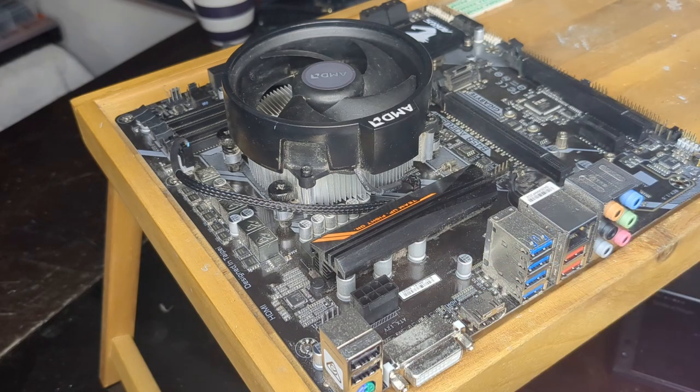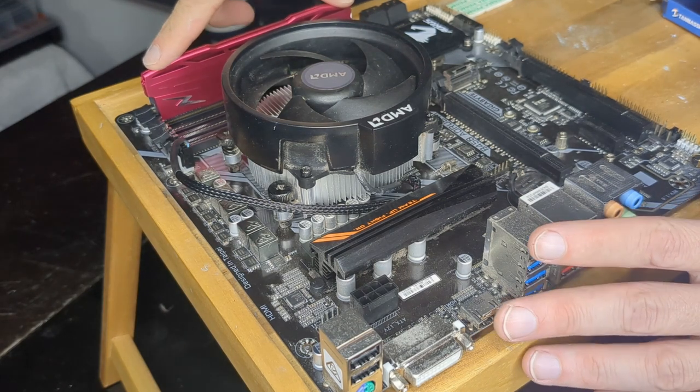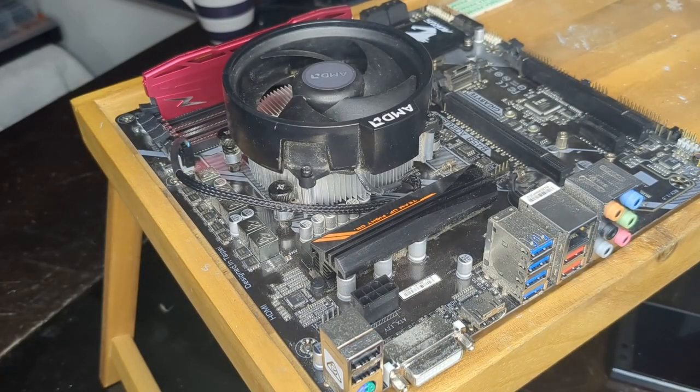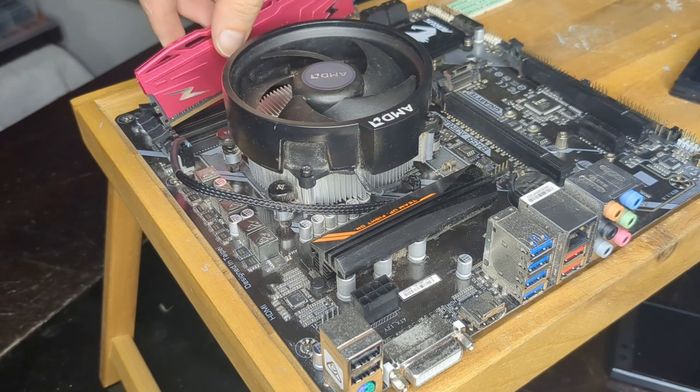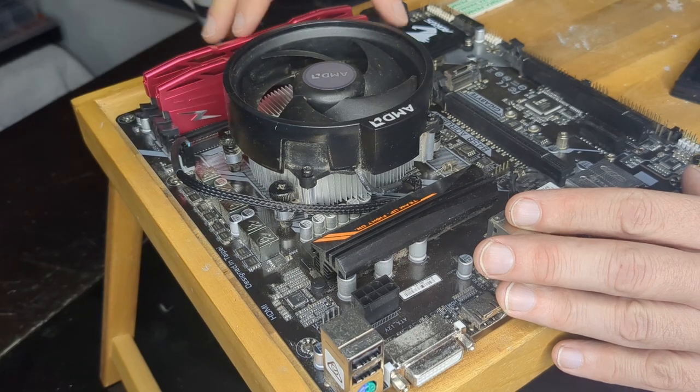Now I'm going to install some RAM. I've got some RAM kits here — there's a brand new one. They're a sort of Chinese brand, but I've used them before. I got 10 sticks of these, so I'm pretty confident with these ones. The rule of thumb is you do the furthest away RAM slot first, and then for the second one you skip one slot and put it in the next one over. That'll give you dual channel in most cases. So there's those installed.